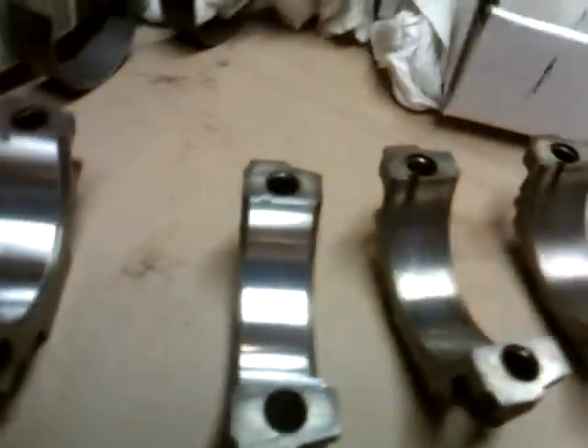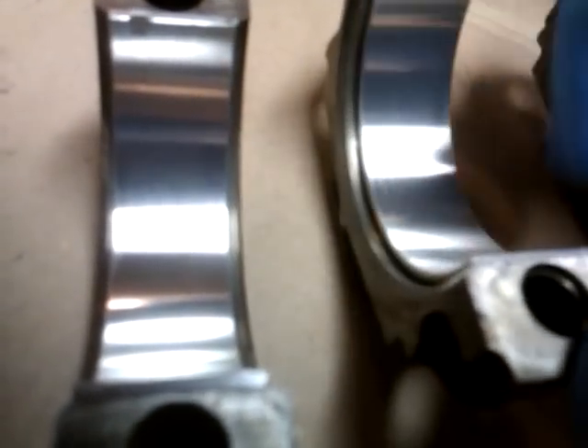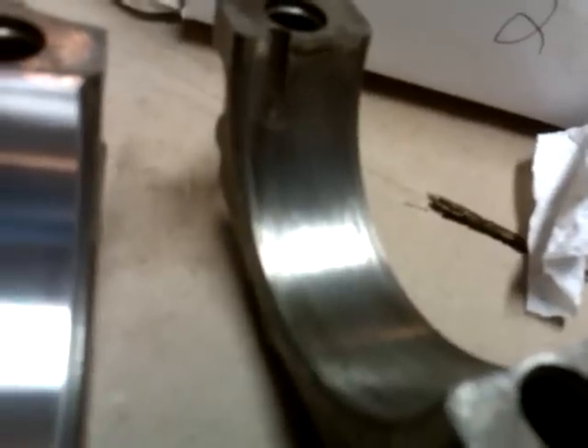And the next one. I'm just grabbing them as they come out of the pack — there was no oil on them, I'll wipe the back of a couple of them. You can clean them with brake parts cleaner on the back side; it won't hurt anything — these are polished, ready to go. Make sure you clean this side out with some brake parts cleaner and napkins about twice to get any oil from back there. And if your bearings come oiled to keep them from rusting, then you clean them with brake parts cleaner before you pop them in.